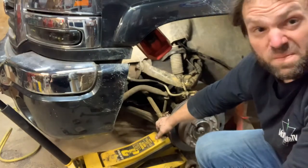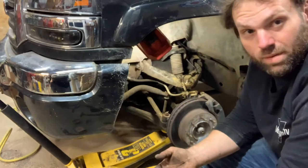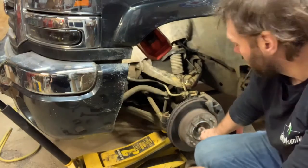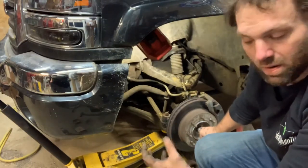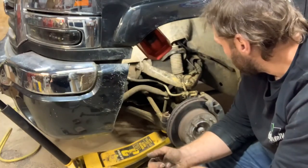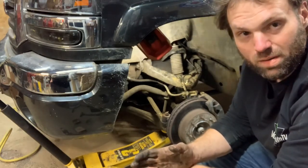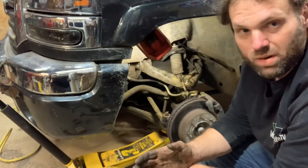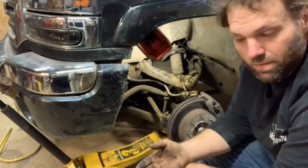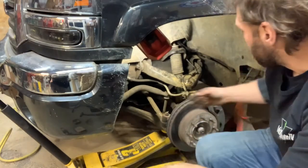You got to put your tie rod and everything back in. So basically all I got to do now is put the wheel on, drop it down. I'll torque this. I don't know what this torque spec is. Google it. I'll put it in the comments or in the description of the video, what the torque for this is. Torque that guy. There's torque specs for everything, and I'm going to tell you, do as I say, not as I do. You probably should torque them, but if you've been doing this for a long time, you know. Some guys get a torque wrench out for everything, and that's fine. There's nothing wrong with that, but there's a lot of guys that don't. But just make sure everything's good and tight.